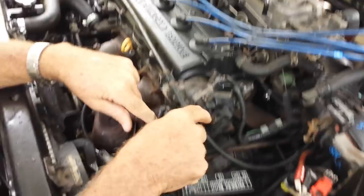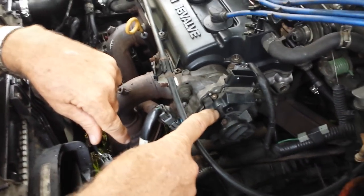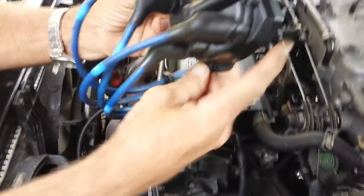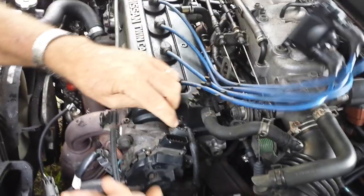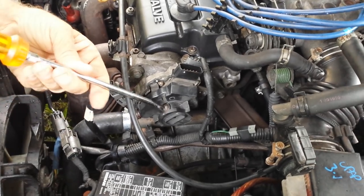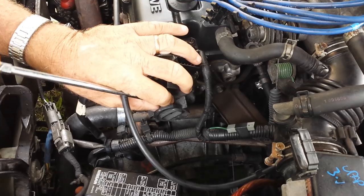So Charlie, what do we have going on right here? Inside here is the camshaft sensor. Hidden behind this, our cap goes right here. You take the cap off first with the three bolts that are on here. And when you get to this, there's a bolt here that holds this little armature piece on here, so you unscrew this. This one has been hijacked before, so that's why it looks a little odd.